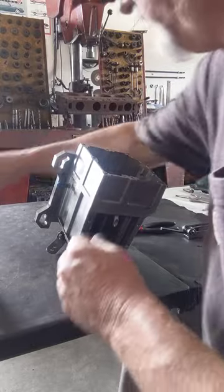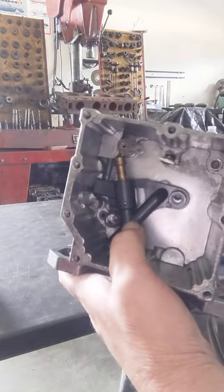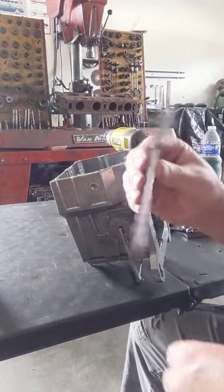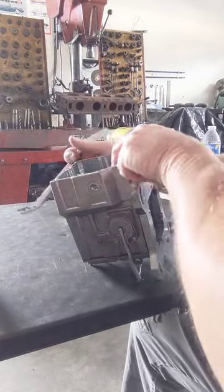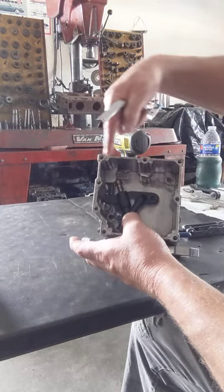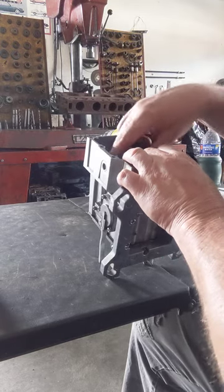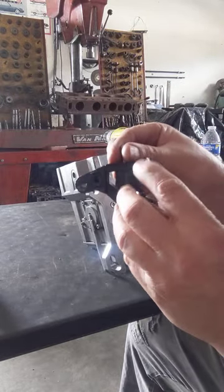Okay, it only takes two of those. So basically, that's what it looks like. There's your spool, and then you want to pull that spool out. Sometimes they come out real easy, you can pull them out, but I've got this from the parts house, just a brake tool, and I just cut a notch in it. So I kind of go behind right here, that's where the idle mixer screw is straight down. Well, it's hooked to that. You'll see when you take your cover off. And I kind of go behind it with this. Pop it off. This one actually came out pretty easy, so I may have to check this ball joint.